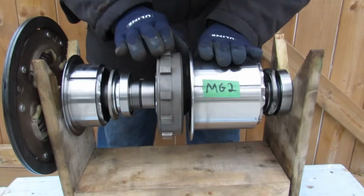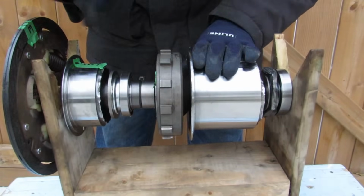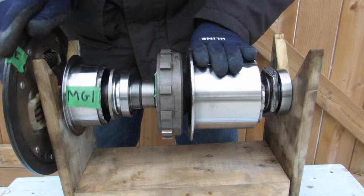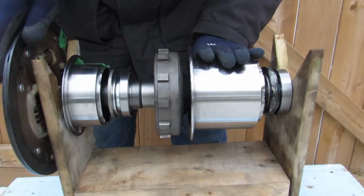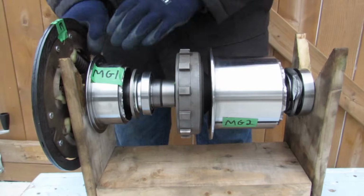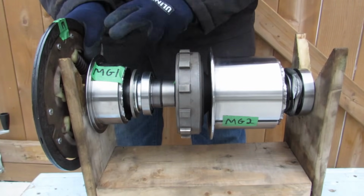Well, that's going to allow the power to come through this ring gear over here and use the compression of the engine in order to slow you down. Therefore, you're not really going to be generating as much energy, but you are slowing down without burning out your brakes. Now in our fifth mode, let's say the engine is off and you want to reverse.